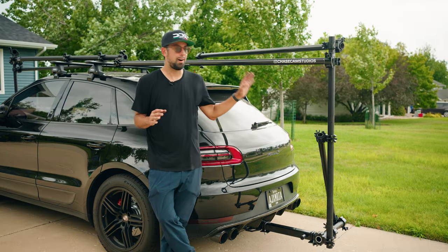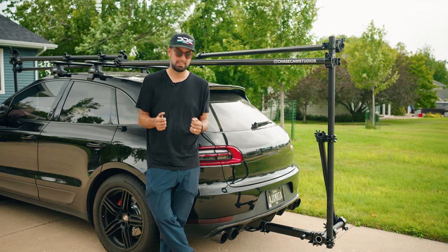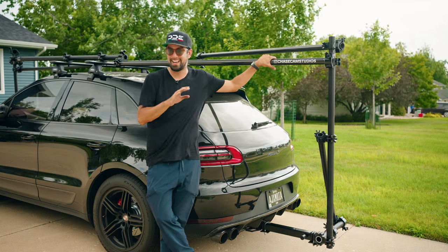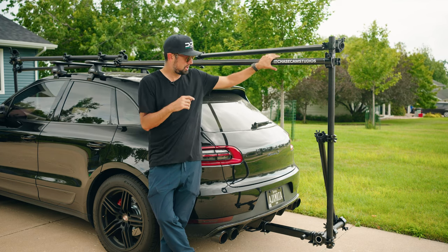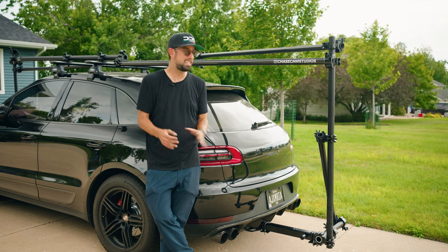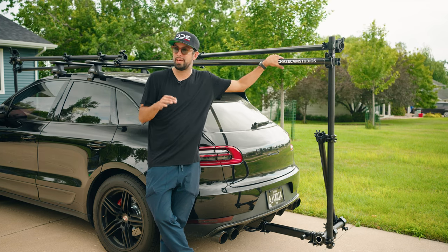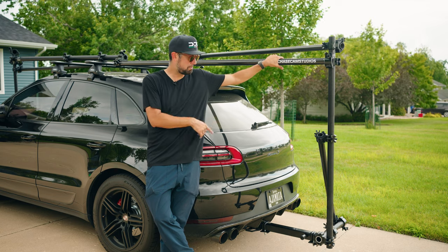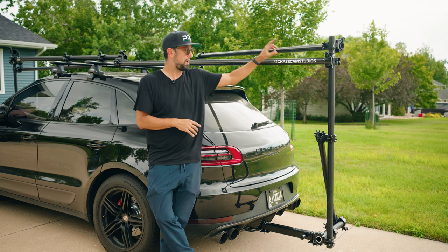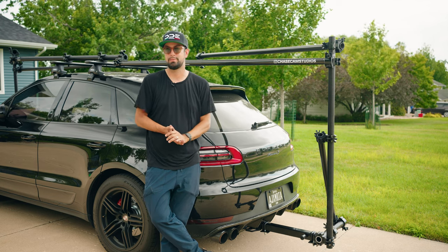So now that we have all of our speed rail connected, I'm gonna make sure that everything is where I want it. And then I'm gonna take the crescent wrench and tighten down each individual joint just to make sure that nothing is going anywhere. I'm gonna start at one end of the car and work my way around just to make sure I get all of them. And like I said, I leave every single one of these at an off angle. That way I know that it hasn't been torqued to spec. So if you're doing a build that's similar, it's always smart to have one setting for how you want each nut to end up. That way you know that it is torqued to spec.